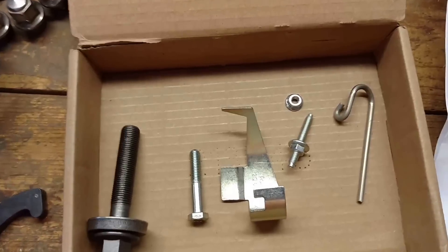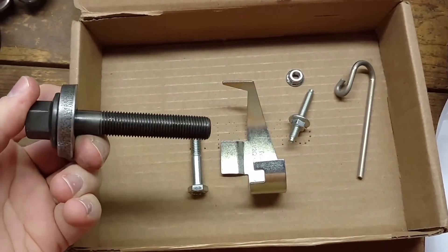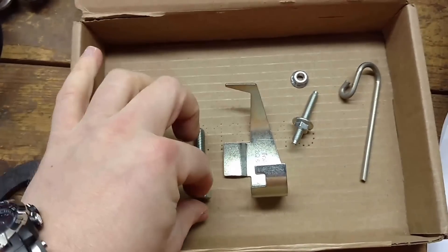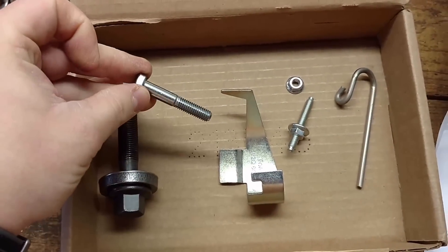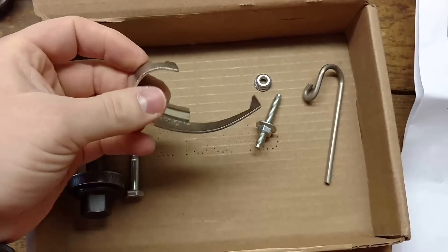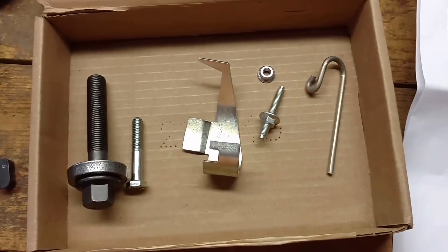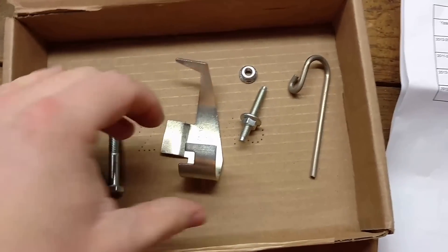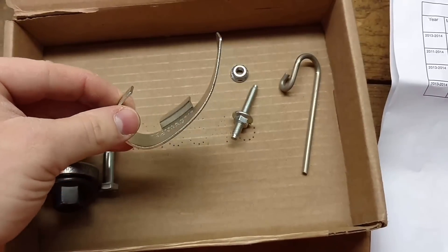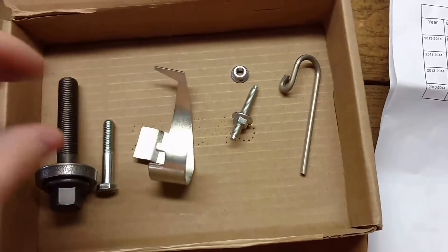Here are some of the parts you'll need. This is an M14 crankshaft pulley bolt. This is the tensioner pulley bolt. This is the installation tool for your serpentine belt since it's a stretched fit. You'll attach this to your crank pulley and then it'll just rotate around your crank pulley and stretch the belt on there.